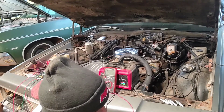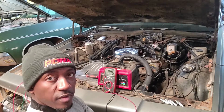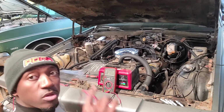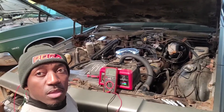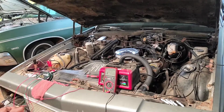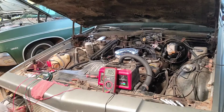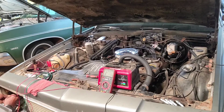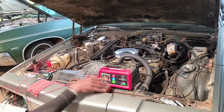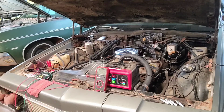And then on the low beam side, 0.005 ohms. So I'm gonna go to the ones on the other side of the car, which y'all should be able to see when I go over there. I got ground there, 0.005 ohms. And I got ground on the other side.